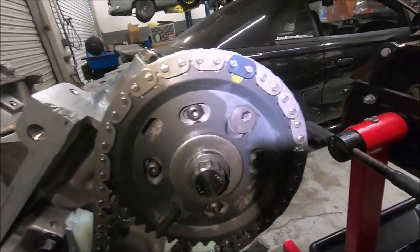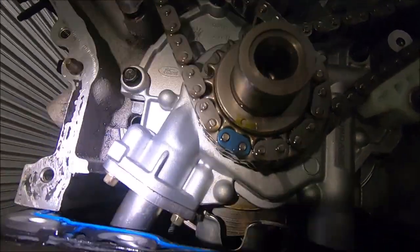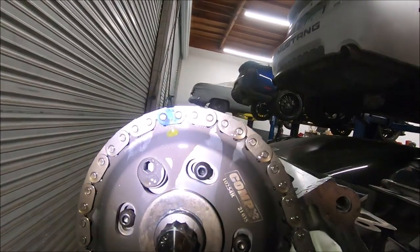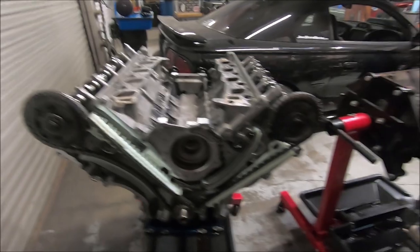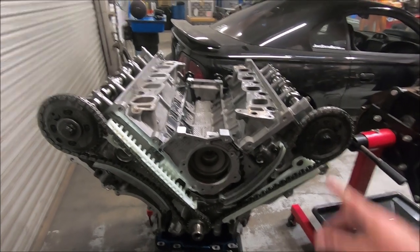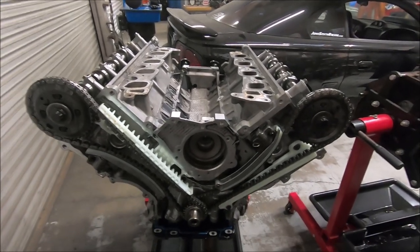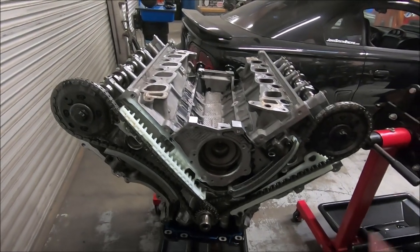Lastly, you want to check and make sure that your dark links are lined up with your dots — those are lined up, and lined up up here. I'm not going to pull the pins on these yet and I'm not going to torque these down yet, just in case when I do the timing on it I have to pull them back off. So that's basically it — now we've turned our short block into a long block. The main difference between a long block and a short block is obviously the heads. But if it's a pushrod engine, a short block will sometimes have the cam in it. In the next video I'll show how to degree the cams with these Comp adjustable gears — I love these things, it makes it so easy.